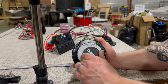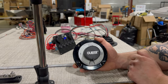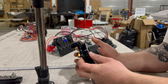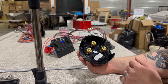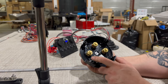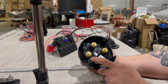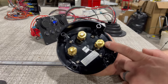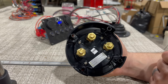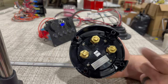When I'm all done at the end of the day or I'm trailering home, I change it to off after the motor is turned off. Now I have no power going out to my motor or accessories. The backside of this switch is going to have three posts — they call this a feeder, sometimes you'll see it called a shared or common, that's all the same. This is battery one and this is battery two. Let's show you how to hook this up to run your two batteries on this four position switch.